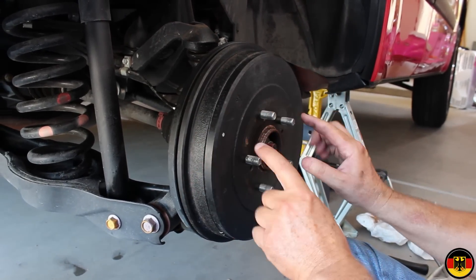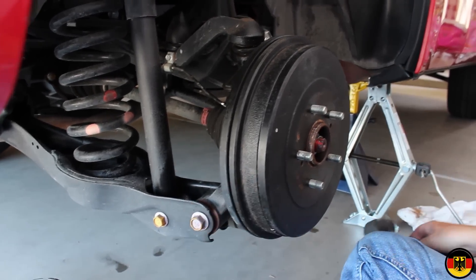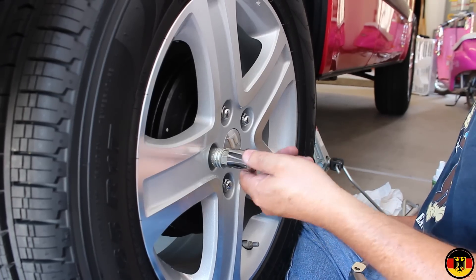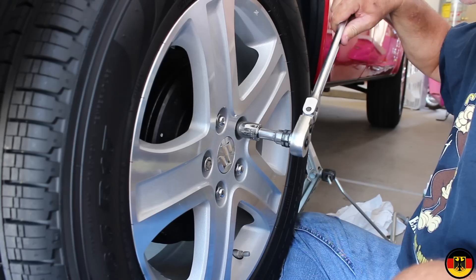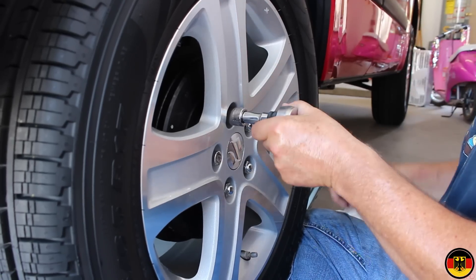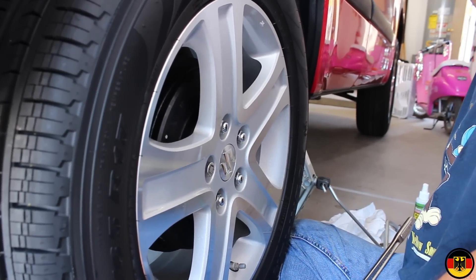I just reinstalled the drum — the drum is held in place by the lug nuts, and when I put it on, I lightly tapped it with a rubber mallet to seat it on the machined area, which fits on tight. Now I'll put the wheel on and torque it. I'm using a 19 millimeter six-point socket with my breaker bar to snug the lug nuts up in a crisscross pattern — they'll tighten down a good amount since you're also squeezing the drum on. Then I'll remove the jack stand, lower it down, and use my torque wrench to torque them to 75 foot-pounds, which is 100 Newton meters. And that's all there is to it for your rear drum brake inspection.